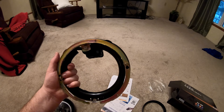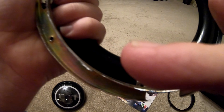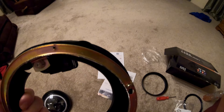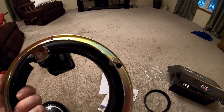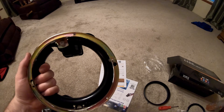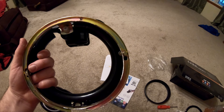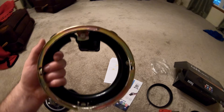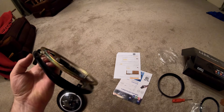I saw a guy use a nibbler — I think it was Makita brand — and you go all around here. This area normally has these little metal strips, and you can see if you look closely they're trimmed. I don't have a nibbler, so I used a bench grinder and just ran it around like this until I got the right shape. Nothing on the inside ring is what you want — you want it to sit flush. The little tabs come out about half an inch; there are three sections and you have to trim them all off, all the way down.